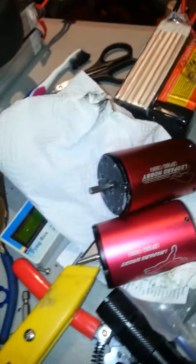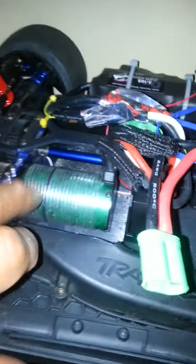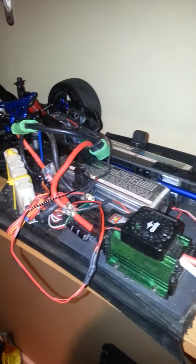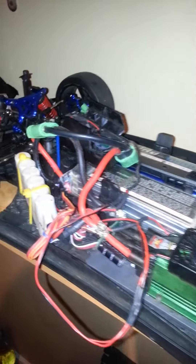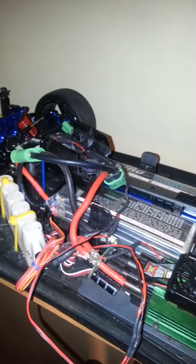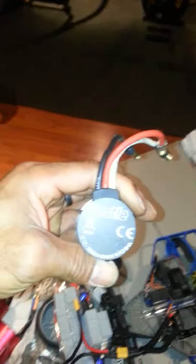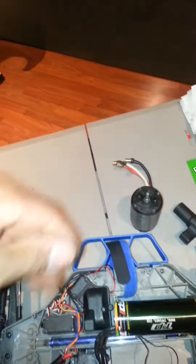I've got the two Big Boy Leopard motors. I'm going to put those in both of these X01s. This motor is coming out. I've got the Crenshaw motor mount coming in — I bought two of those, one for each. Now I took this one out yesterday and was messing around with the amperage and the Castle Link, and unfortunately I wound up burning this motor out. Somebody told me they can take 8S but it didn't really hold up too good. You can see the spinner doesn't really have any torque to it — you can turn it real easy. So that's done.